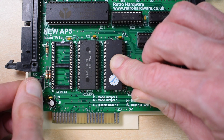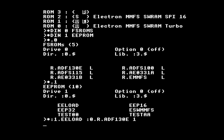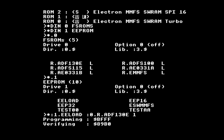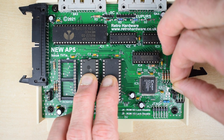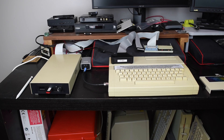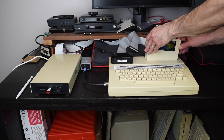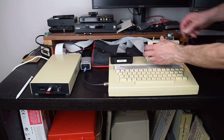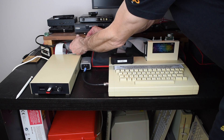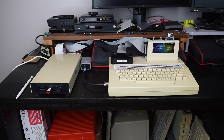So now I can set the jumpers to enable programming of the EEPROM, and use the Elk SD Plus One again to run the EE Load utility to write the ADFS 1.30e filing system ROM into sideways bank 1. I can't use the new MMFS in the AP5, because it won't have the workspace RAM mapped in when the jumpers are set for writing to the EEPROM. Once we've got that sorted, I can put the jumpers back to MMFS Mode 2, and insert my vintage Prez AP3 floppy disk interface cartridge in the Plus One's rear slot, and the new AP5 in the front slot. The Pi 1MHz virtual hard disk connects to the 1MHz bus port on the left-hand side of the AP5 and needs a separate USB power connection. Then we can turn everything on, starting with my GoTek virtual floppy drive, and finishing with the Electron itself.